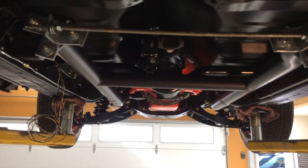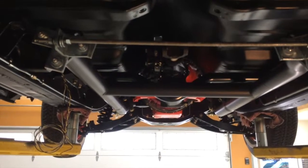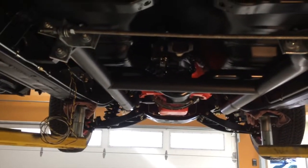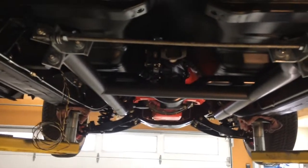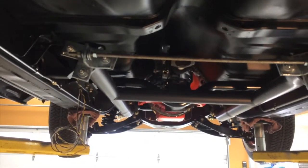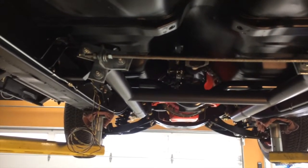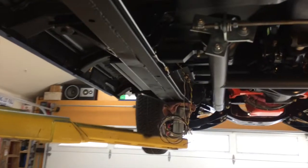I would say it pulled in the middle, so that the two ends here were narrower than when they got fabricated. So what we ended up doing yesterday, we came up with this idea of putting these brackets on the flanges and putting the rod in between the brackets and spreading the two ends out until the bolts on the hangers were hanging straight.